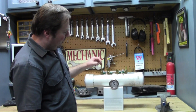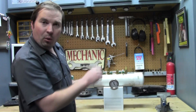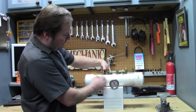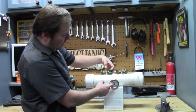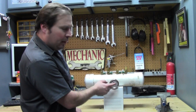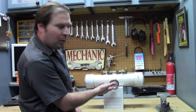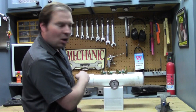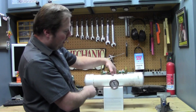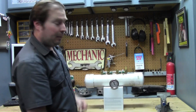What you do is hook each one of these up to each one of the intake manifold ports and open them sequentially. Take a reading, close it up, open the next one, take a reading, and so forth, and make sure your carbs all measure the same reading on the gauge. The number actually doesn't matter — it's just as long as all of them read the same. If you have one that's different, you go and adjust it and keep going back and forth until you get them all giving the same reading.